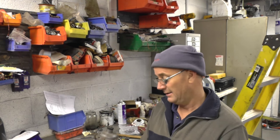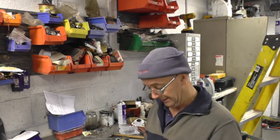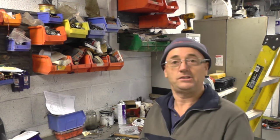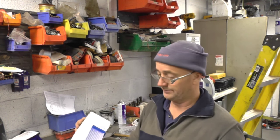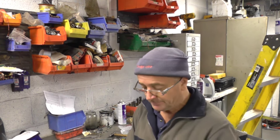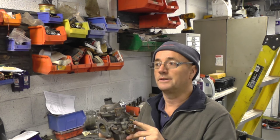Zenith CD 150 — on this model, being the emissions model, it's the CD 150ES, which has got the emission setup on it. We're going to rebuild it with the full overhaul kit, not just a service kit. I opted for the full overhaul kit because after 40 years of operation it probably justifies it. I bought the kit direct from Zenith in the UK — comes in a box with plastics, diaphragms and all gaskets necessary.